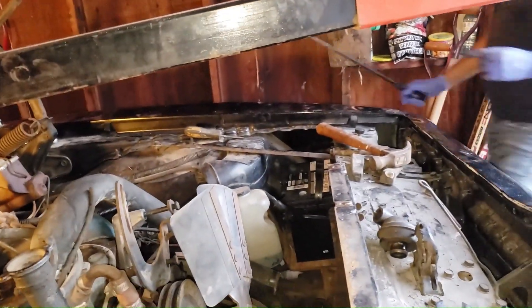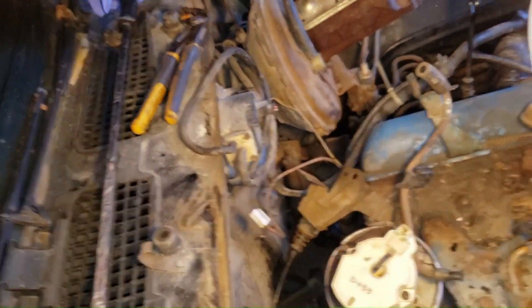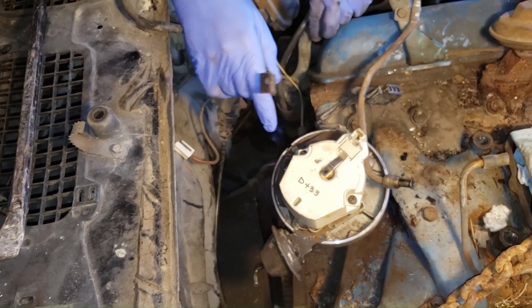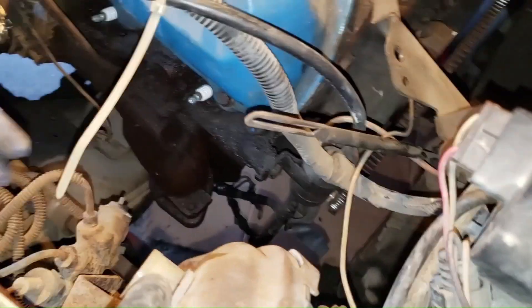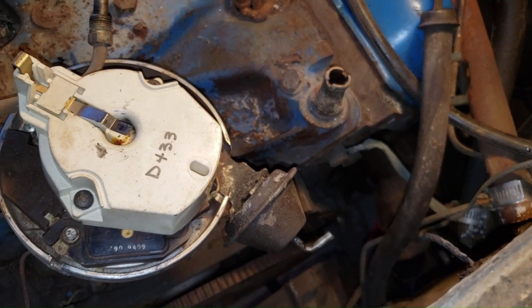There she goes, Freddy — that's what I was planning to do. And these wires go through this little bracket right over here. I'll show the world — these wires here are going through this bracket, so I'm going to undo this bolt here and take the bracket off. And then there's a ground strap on that side right there. I'll do those couple things and this thing should come right out.